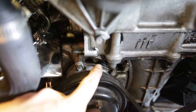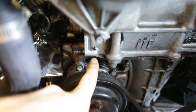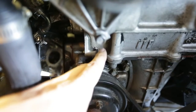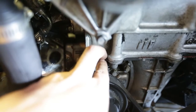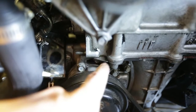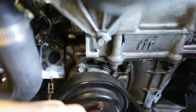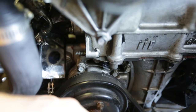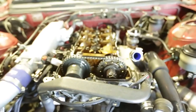I've been trying to figure out why there's a massive oil leak here, and there's an oil passage that leads for the chain tensioner. I just slid a razor blade in there, and what I noticed is the head gasket that's supposed to seal the oil passage doesn't seem to be there. So I'm not sure if that's an oversight I missed, or it's an improper head gasket. But it looks like this engine is going to be coming out once again in order for me to fix it.